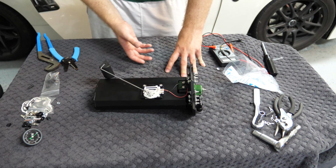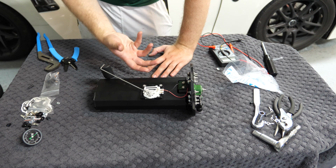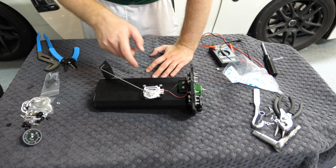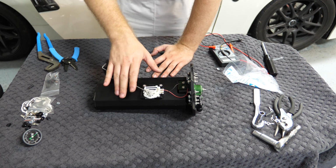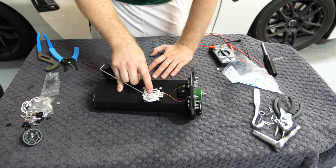Normally you won't actually have to open up your surge tank. It's just in my case, I only wanted 2 surge pumps, and you don't have an option to do just 2 surge pumps without a lift pump. So I ended up installing my lift pump in here myself. But normally it'll just come with however many pumps you want installed. The only thing you'll need to do is actually put that level sensor on.